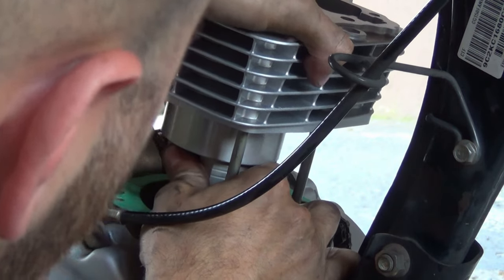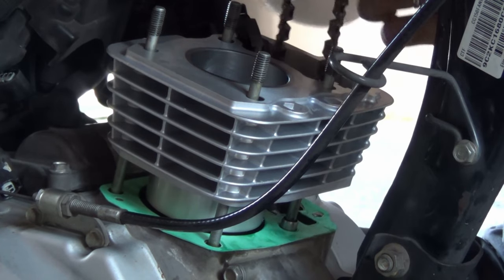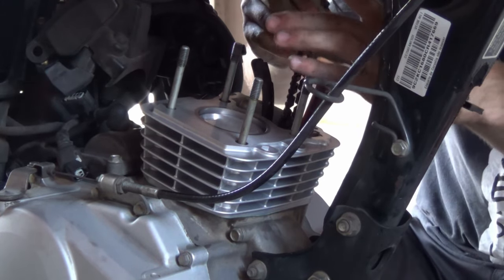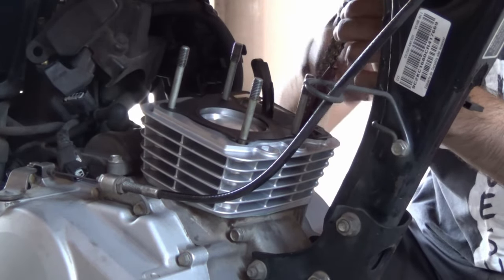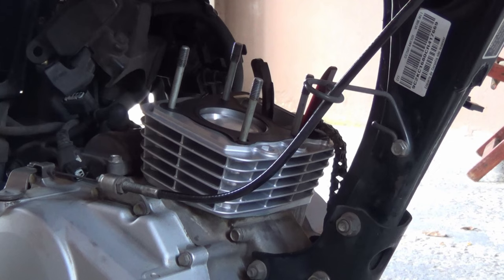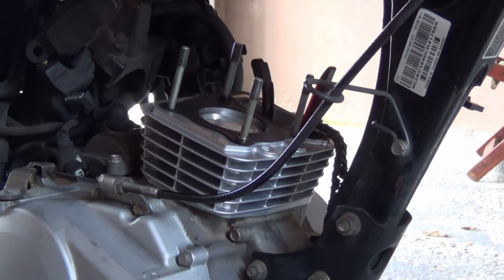This is so nerve-wracking — oh, the tension. This is really tight. Now we are ready to install the head gasket. We'll bring the timing chain up, pass it through the gasket, and seat it right there. This would be a great time to install the guides back. The same thing goes for screws — if these things go down in there they will wreak havoc. Coming back to my senses, this was a good idea — not so much for fuel economy, but for engine health.